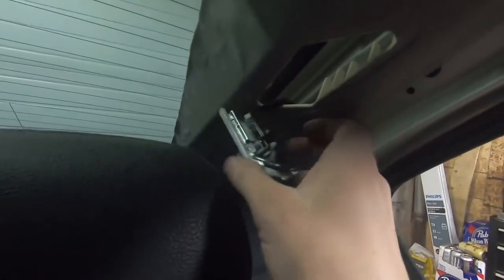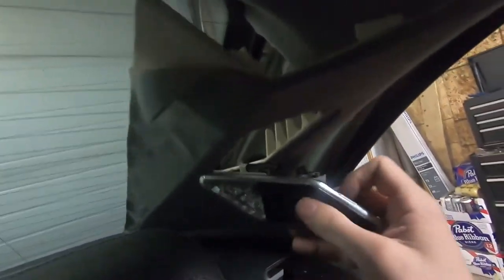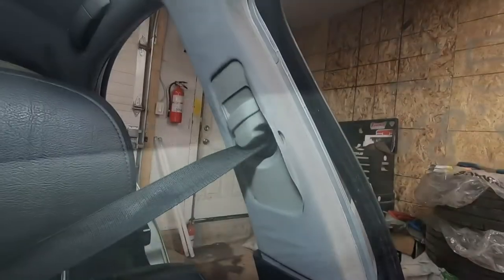For the rears, you can see I've already got it almost all the way out. The first thing you need to do is pry the light out — just take a slot screwdriver up in here and pry it out. When it's sitting up there, you take a slot screwdriver or some sort of plastic pry tool and pull it down, because it just clips in with these plastic clips. Then you wiggle it up to pull it out the bottom and feed your light through.